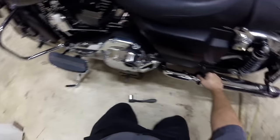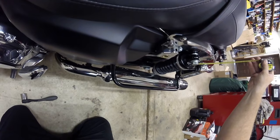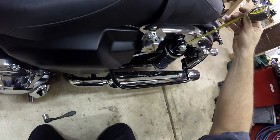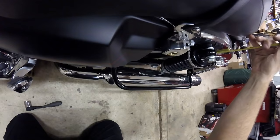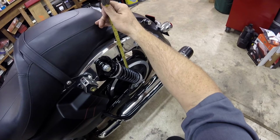Let's bounce here a little bit. Of course, I got the jack over there or the tape measure where I can't get to it. All right. I still kind of have the jack there as a little safety. Yeah, see, I'm not gonna be able to hold the tape measure in the spot where I had it, because I had it slightly bowed. That's nine and a quarter. This is just absolutely a rough guess. Yeah, I wish I could get my hand in there. I should have used the axle there for that, huh? That's showing about 9 1/2. So that's an inch of static.